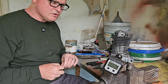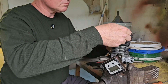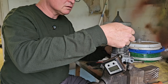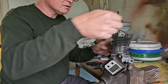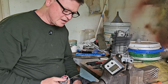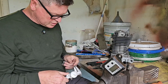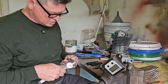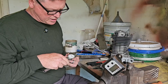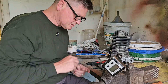First off, we're going to check the squish. Okay, so it is hitting, but barely. There's no flywheel or anything on here. I'm just able to spin the crankshaft by hand. There are no rings on the piston, that's why it's turning so freely. We're looking at a squish of about 63 thousandths of an inch.